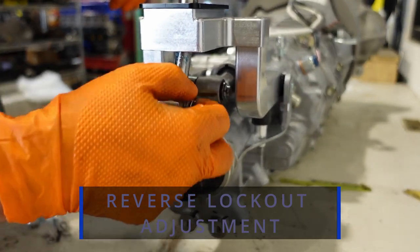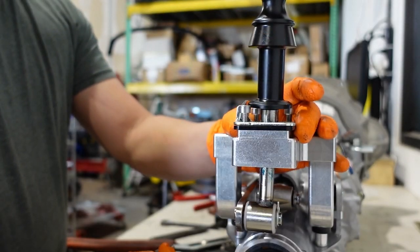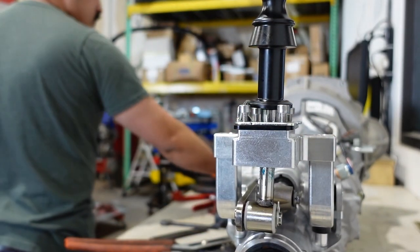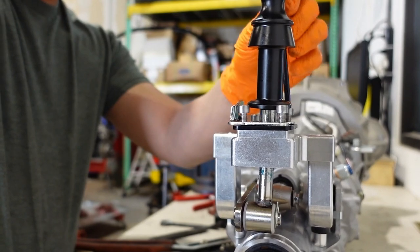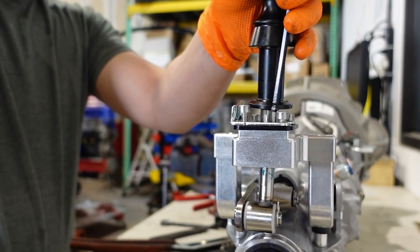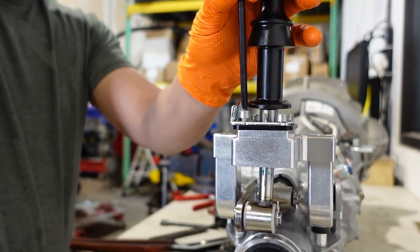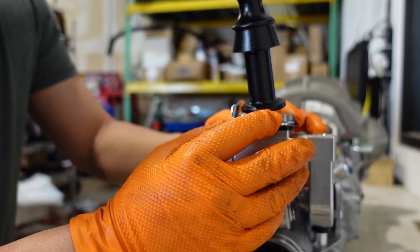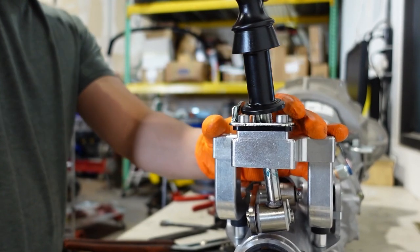The reverse lockout is a small plate that installs on top of the shifter plate and keeps the reverse lockout knob from traveling too far and engaging reverse instead of first gear. If not adjusted properly, you could end up downshifting from second into reverse instead of second into first. Lay your reverse lockout plate with the lockout lug facing the driver's side. There are four four-millimeter Allen hex screws — apply red Loctite to the threads and thread them down finger-tight, leaving enough slack to slide the reverse lockout plate left or right. Put the transmission in second gear and slide the plate until it touches the reverse lockout knob, then back it off about an eighth of an inch and tighten all bolts.